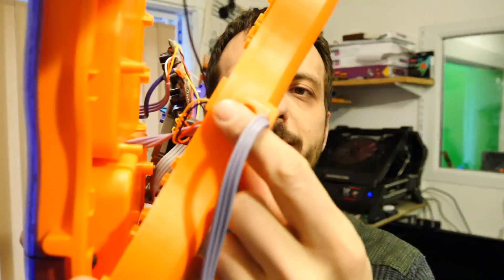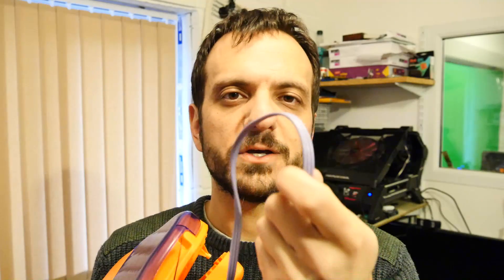Looking on the back, you'll see there's a power port that comes in. I'm not sure if I'm going to retain that, because it's a little bit dangerous - if you plug in anything above 5 volts into the Raspberry Pi it'll blow up, so that's why they use a micro USB connection, because micro USB spec is always 5 volts, well up to 5.25. So unless I add additional regulation circuitry I can't really use that, but it depends how stock I want to make it.